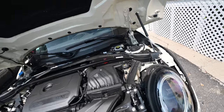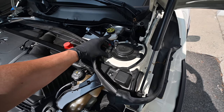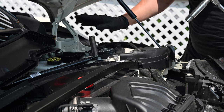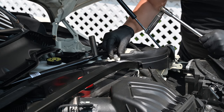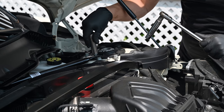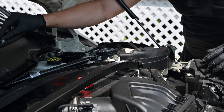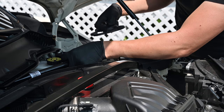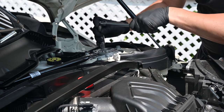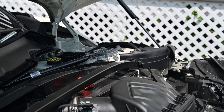From there you have access to the top suspension bolts - it's a 16 here for the strut bar and 13s here. We're going to lift the car up, take the wheels off, and inspect what we have to take off for the bottom side as well. With the car in the air, I already loosened this one - got the 13s here and then two under the cover. You've got to take that 16 off first. Those are all broken free, let's go see the bottom.